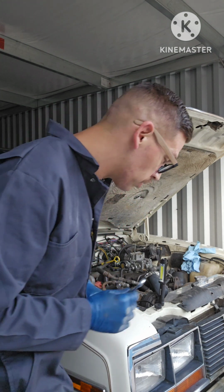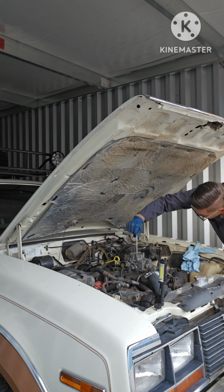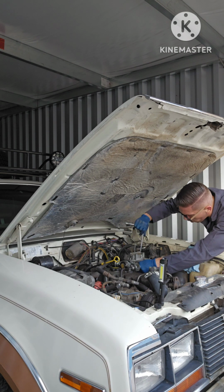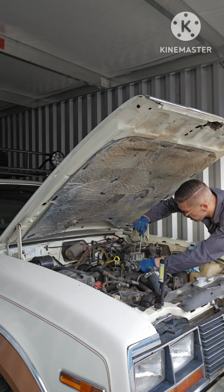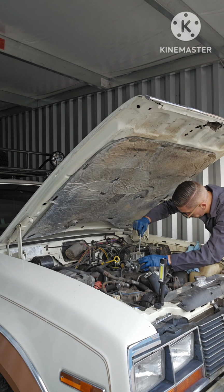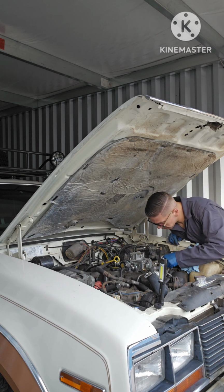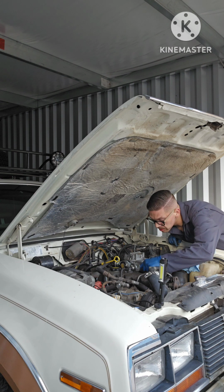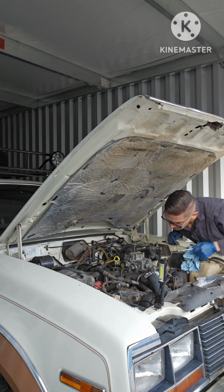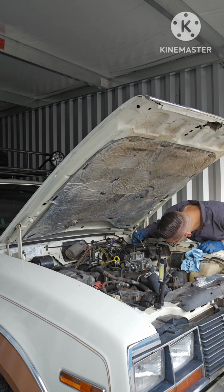Okay. I know you're not supposed to torque those too tight, so it should be good. I don't know if you're supposed to use lock washers on a carburetor, but I did put hardened washers under it so it doesn't tear into the base of the carburetor since it's aluminum. I did that because there originally weren't any lock washers on the carb. It was just some jam nuts. And when I pulled the carb off, it was loose, creating a vacuum leak at the base. Should be good.